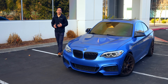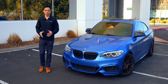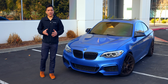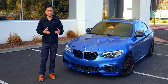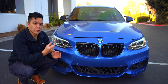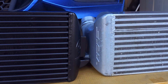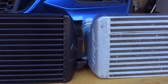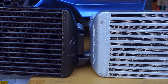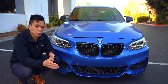With all that in mind, hopefully this video has given you enough information to install, as well as the confidence to select the proper intercooler for your BMW. But if you're picking up a used one and still are unsure on how to tell the differences between a bar and plate intercooler: when you look at the front of the intercooler, if you have a small gap right where the fins meet the end tank, then this is indicative of a tube and fin design. But if it appears that those fins go past that meeting point and you have a pointy prominence on the bar section, then you probably have a bar and plate intercooler. This is evident on both the Wagner and VRSF intercoolers.